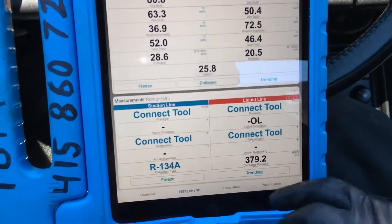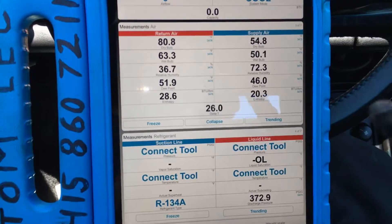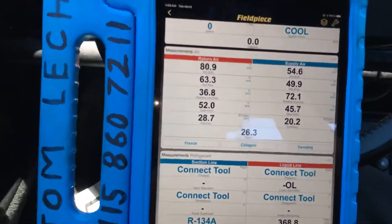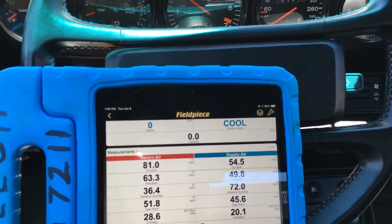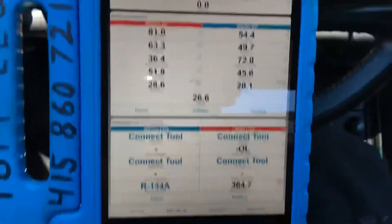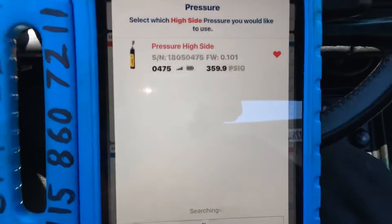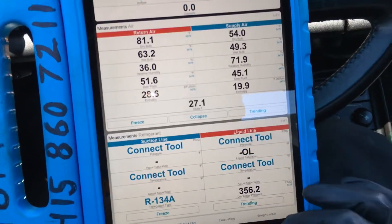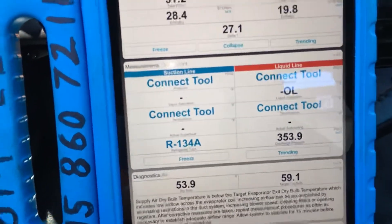If it was a 100 degree day and this is already approaching 400 PSI, no way. So I could understand why that compressor sounds funny and it felt wrong — it sounded wrong. Because somebody probably followed the manual and came up with that. Something's definitely wrong here. It looks like it has the original receiver drier on here. This came from Japan, it's in California in Burlingame right now, and it's being shipped to Wyoming — out in BF nowhere. You can see the high side is going down when I'm up at 2,000 RPMs. If this was moving down the highway it would be a little bit lower, but that's still too high. I'm going to snapshot this.